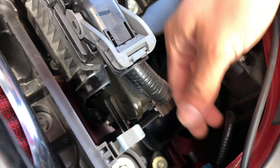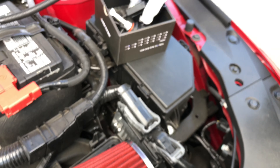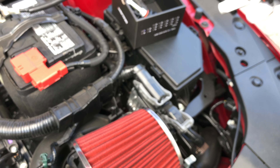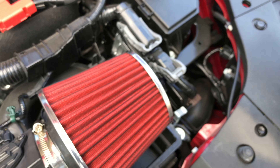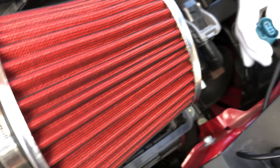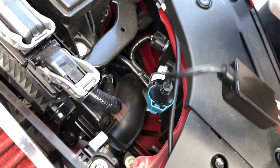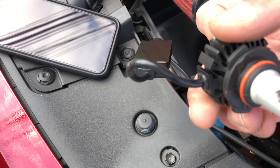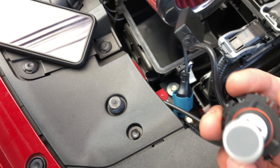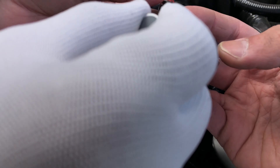To swap the bulbs: the standard one is right there — you just unplug it right there. It's the blue one — twist it counterclockwise, towards your right hand, and it comes out. Installation: just plug and play. There's also a controller module that comes with it — you should find a spot to put it somewhere. There are three brackets to line them up.